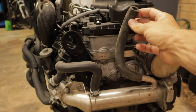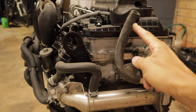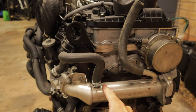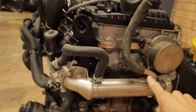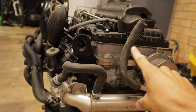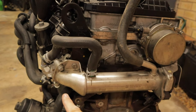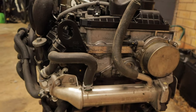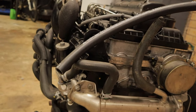This is the pipe that originally connected to our heater core. Now we've disconnected this one, and in doing so, you've bypassed this whole cooling system here to where it comes back down to there, and completely stopped the fluid from coming into this cooler pipe and leaking out into your engine. So now with your new bypass hose running in, it'll come down there, and I'll show you where to connect it to next.